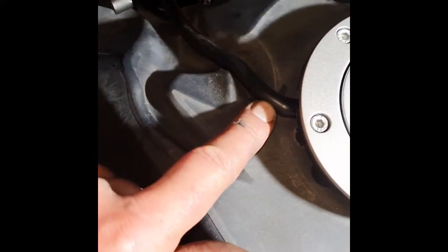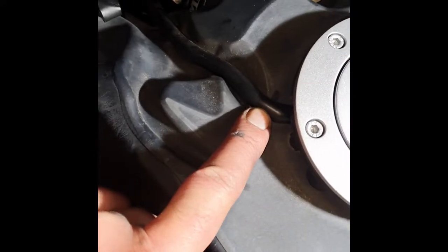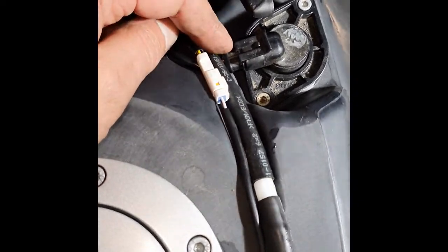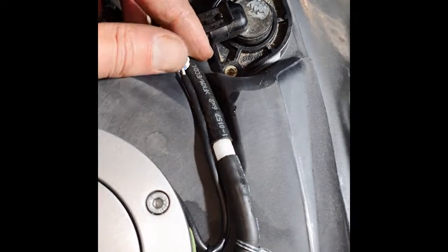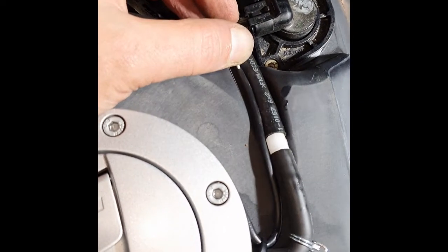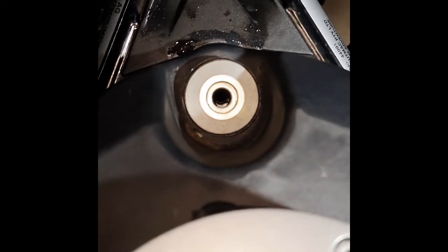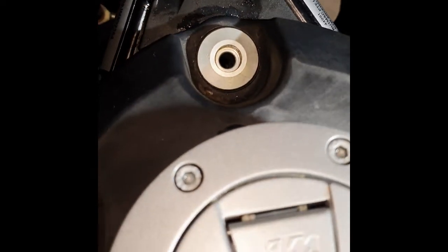On the top of the tank there is that pipe — that's the water drain away. This is the fuel return, and there's that connector at the side there that we snagged as we were taking the tank off the bike. Don't forget that connector — it needs to be pushed home. The screw holes look pretty well bang on, and I can see there's a hole all the way down the middle there, so we're going to put the big 6mm bolt down there.